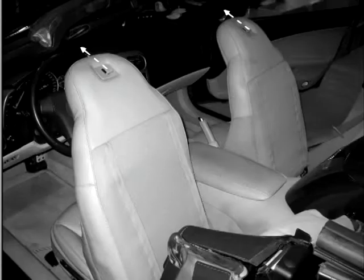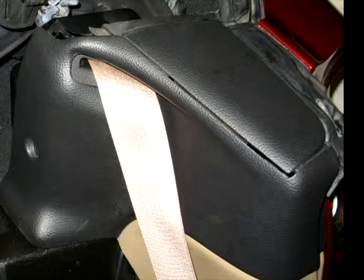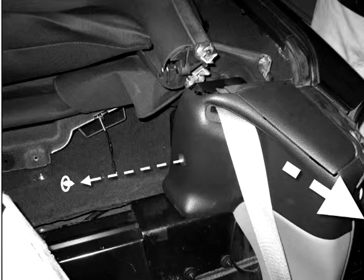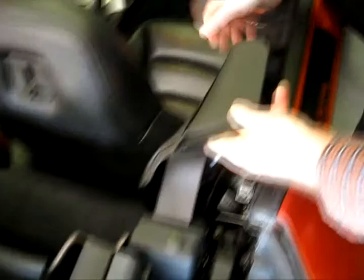Now we're at step two. From here on we will be applying the same step to both the driver's and passenger side. At this point, it will help if your seats are in their furthest most upward position. Let's go ahead and locate the seat belt cover panels and remove them. These are held in place by a screw rivet on the side and one clip to the front of the panel. If you lift up the flap on top of this panel, you can see down behind where that clip is located so that you can remove the panel.